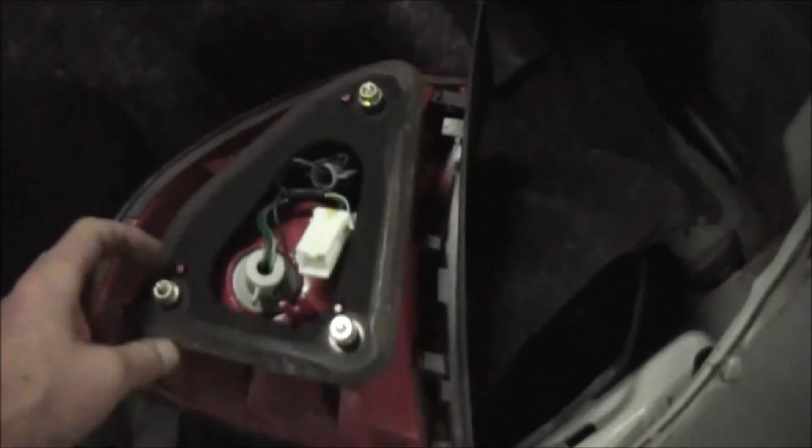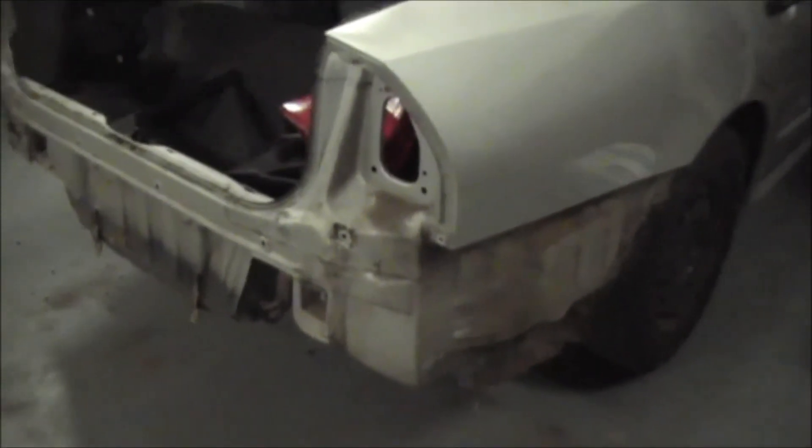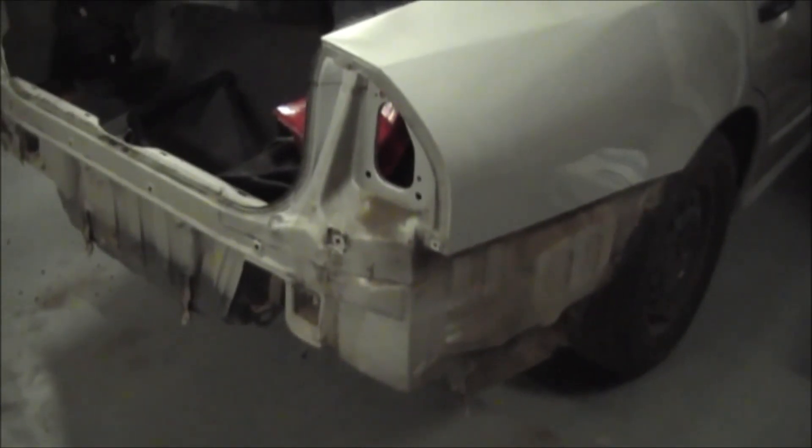I decided to move on and do a few more things. I've pulled the boot off, pulled the tail lights out, boot seal out, and pulled the wiring harness out with the tail lights. Tail lights are pretty easy — just one, two, three bolts and the connector, and they're out. So for taking things off this car, that's the rear end done. Ready to start doing the front end. I'm really looking forward to taking those headlights out — I want them for my car. See you later.